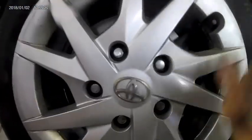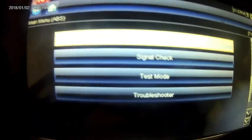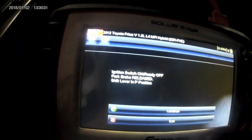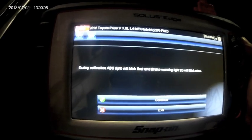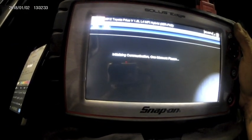We still have one more thing to do — we have to relearn the linear valve offset. Clean off all residue previously sprayed from the brake bleeding procedure, then reinstall the wheels and bring the car back down to the ground. Grab your scanner and scan for codes — you should have two codes, one of which should be linear valve offset not learned. Scroll down to functional tests and click on linear valve offset relearn, then follow the instructions and press start. At one point the ABS and traction control lights will flash quickly — if they don't, there may be something else wrong with your ABS system. The whole relearn procedure takes about two minutes, with the lights flashing at about one minute in, so be patient.